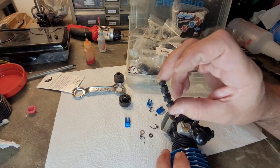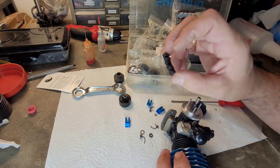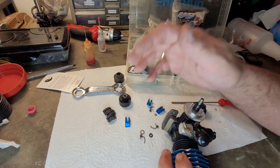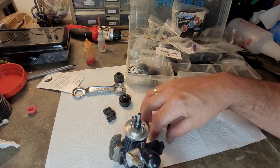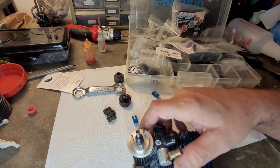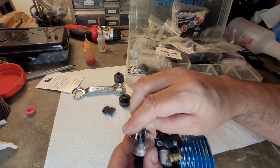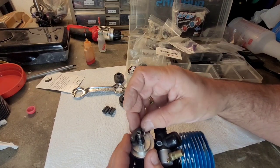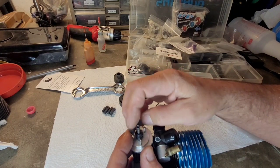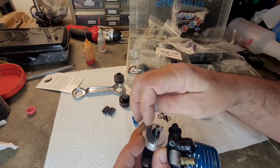And I tell you what, to me, the springs are so much more important than the shoes. A good, firm spring is what really does it for me with a clutch. And also even orientation, leading versus trailing, right? A lot of people like, oh, your clutch goes with the clutch shoes, the pin leading the shoe, right? Or with the pin trailing the shoe.